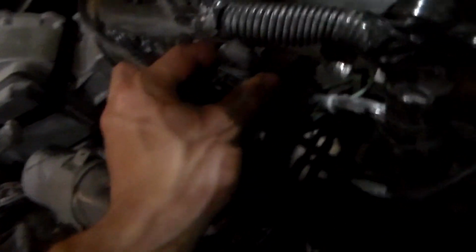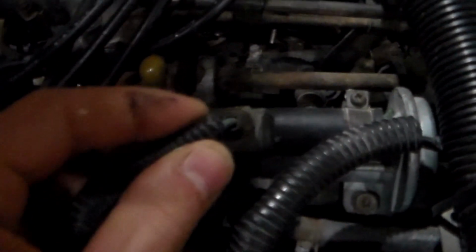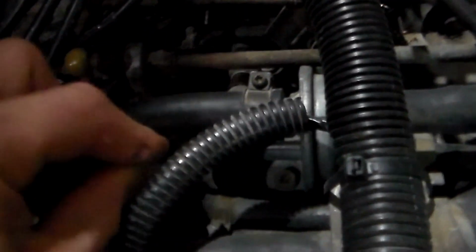You know, rewired it, put the looms on. So, all of these clips, these guys, I replaced all of them for the injectors. I replaced the one for the throttle position sensor, as well as the airflow meter, the coolant sensor, and the thermotime. I still have to do the cold start. As you can see, it just kinda pops right off. And the idle air control, I gotta finish that one yet too. Overall, it's gonna be pretty good.